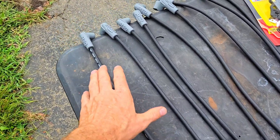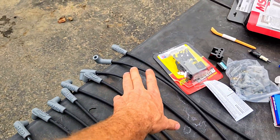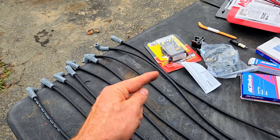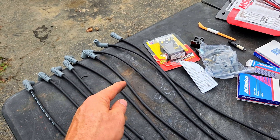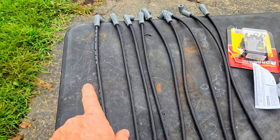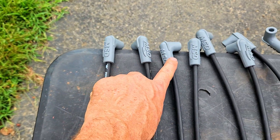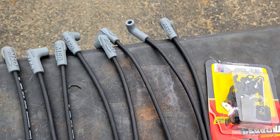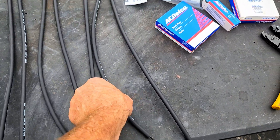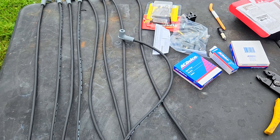When doing my plugs and wires I like to start with the shortest wire for the coil first, because the coil wire — you have to manipulate everything around that coil wire to all eight cylinders. These are different lengths and if you count them there are nine total. The ninth one, the shortest, is what we'll use for the coil wire first.